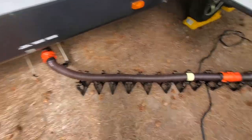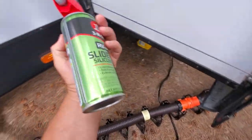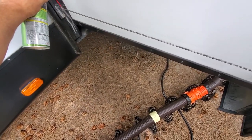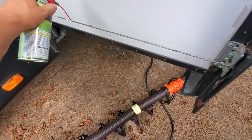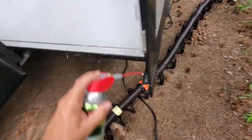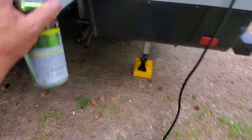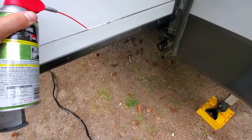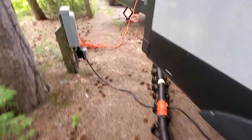While we let that flush, I'm going to hit these cables real quick with just a little RV slide lube — just a precautionary thing. I just hit a little bit of that lube on the cable like that, so as it goes in it's going to do a nice job of lubricating it. Hit the top ones and the bottom ones — just a quick little slide lube on there. It protects those cables and keeps everything working like it's supposed to, keeps it nice and neat.